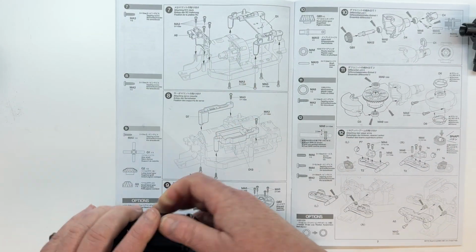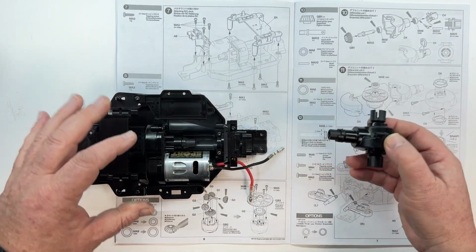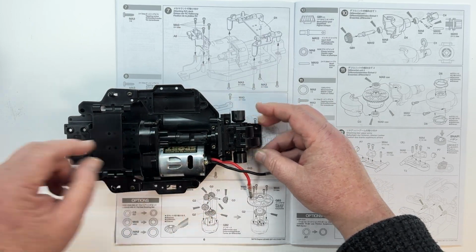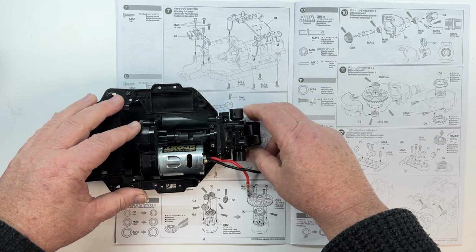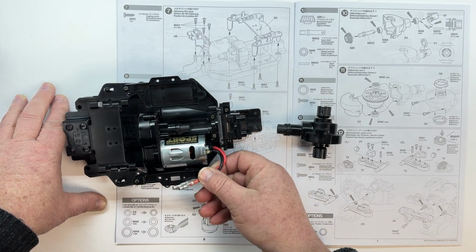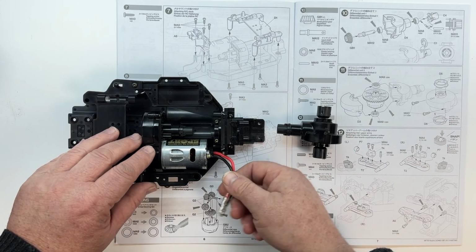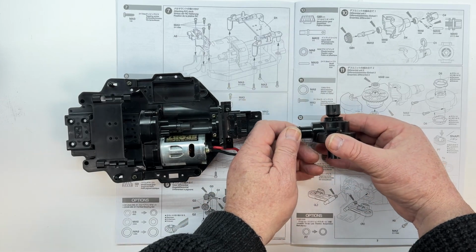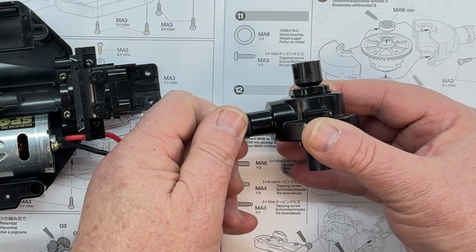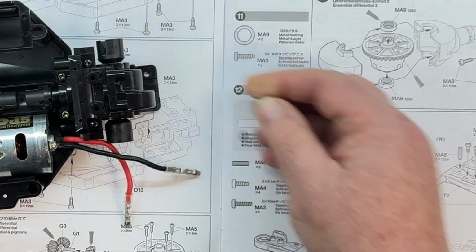Right, so begin to understand a little bit more about how the setup works. So this is your differential, and slots into the back of the car like so. There's a little adjoining piece that joins the gearbox with the diff drive. Now, assuming your motor is always spinning in the same direction because your electrics are all set up, and I guess this is especially apparent for brushless motors, your coupling is always going to drive in a forward motion like so. So always turning clockwise, and you can see both cups rotating forward. So that is the diff sitting in that way round.